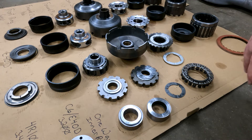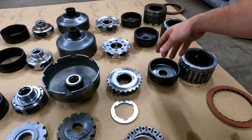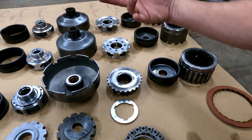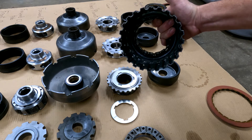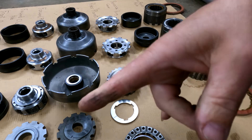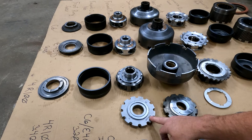The bushings on your rear planet are entirely different — you have to buy those, about $30. When I bought my six-pinion kit, I got the forward half without bushings or bearing for $347 shipped. If you want to use the rear pinion you need the cage — about $40 — plus clutches at roughly $60, the rear inner one-way race at $40, and the rollerized parking pawl at $120.